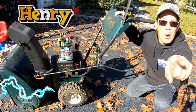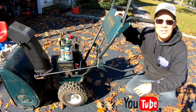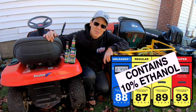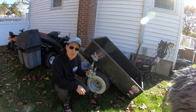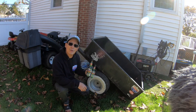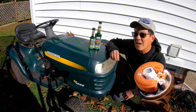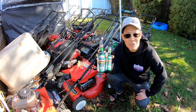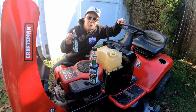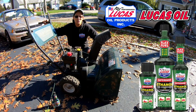Hey, I'm Henry from Mowers and Blowers. As a YouTuber that deals with small engine equipment on a daily basis, I worry about the harmful effects of the 10% ethanol in your unleaded gas from the gas station. Here on the East Coast as winter nears, I think about storing my summer lawn equipment. Ethanol absorbs moisture and can rust, corrode, and clog up your jets in your carburetor. That's why I use Ethanol Safeguard with stabilizers from my friends over at Lucas Oil Products. Before you store your machines, a little bit of Lucas goes a long way.